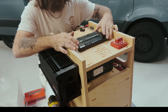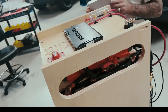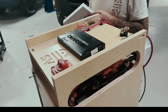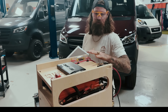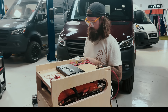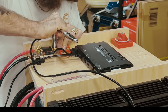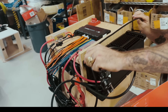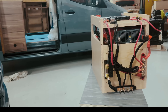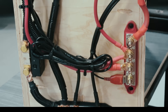The next thing installed will be the TVMS, which stands for Total Vehicle Management System — and this is the brain of the system. You would consider this a fuse box; it's actually a relay box. It has 10 different 12-volt drops on it and you could pull 10 amps from each of those drops. Anything that exceeds that, we either need to put a relay or have a breaker set on this panel. The TVMS has 10 input channels for DC load connections like your water pump and lights, and it also gives your lights a built-in dimmer so you don't have to worry about that at all. This can be connected to the Red Vision mounted screen or it's also available through Bluetooth on an app through your phone. You can still connect physical switches between your loads and the TVMS to have switches in more areas throughout your van.